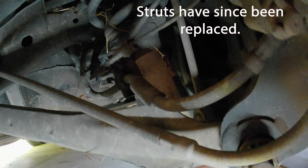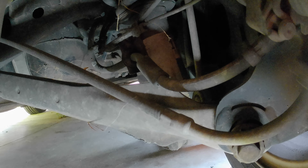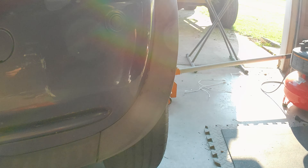The strut mount being shot is probably why this wheel is leaning in and wearing the tire down. The good news is this is a fixed strut - the bottom of the strut is one bolt. That's good because typically, unless there's another problem, when you put this in you don't have to do an alignment. These strut assemblies are not that expensive and won't be hard to replace - a few bolts on top, one bolt on the bottom, a couple accessories pop off.